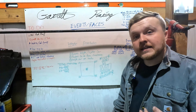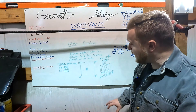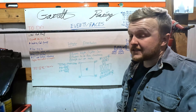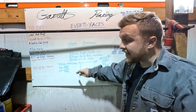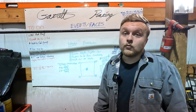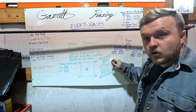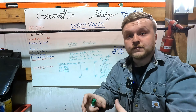That's what a lot of guys get tripped up on. I'd be like, man, I put two rounds in the left rear — I should be getting more left side percentage, right? No. What you actually have done is you've taken away some weight somewhere else and you're still at the same percentage. Now your cross is messed up. You can chase your setup back and forth — I've done it, went all over this car about mad at the world trying to figure out why I couldn't do that. You cannot adjust coilovers to get your weight distribution. You have to do that by physically placing blocks of lead where you want it.